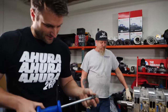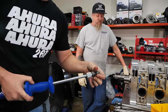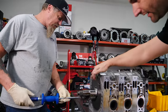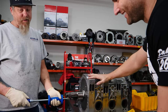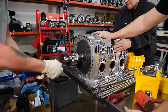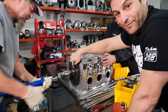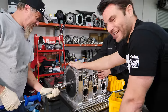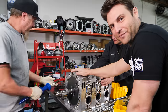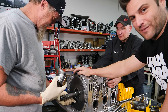We have a bit of a problem — this slide hammer piece goes to this, this goes to this... I say we weld it. As many of you already know, this is a multiple-piece e-shaft — very common for four rotors that the rear one pops off. Four-piece eccentric shaft to be exact. That right there is the reason I took the motor apart. You do not want a single fingerprint, drop of oil, breath, anything on that taper — because there was tons of stuff on there. I literally went out of the way to oil them — put red grease on it — thinking I'm going to make sure this e-shaft stays lubricated. As soon as we got the motor back together the guy from New Zealand that built the e-shaft said 'do not breathe on it.'